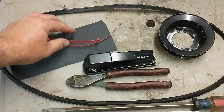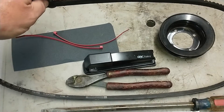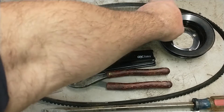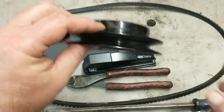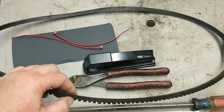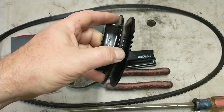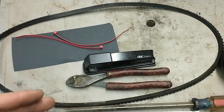I had a brainstorm here. The belt came off — well, let go, basically — on the little Fiero that we've been doing work on, and they don't have a very good belt engagement. What I mean by that is the belt doesn't wrap around the pulley as far as it should. Since the belt already came off, I figured it probably got some schmutz down in the groove here, and I really want to clean that up good without grinding away at it. It's kind of a hassle to get down in there, so maybe I make a tool to dress those pulleys up a bit.